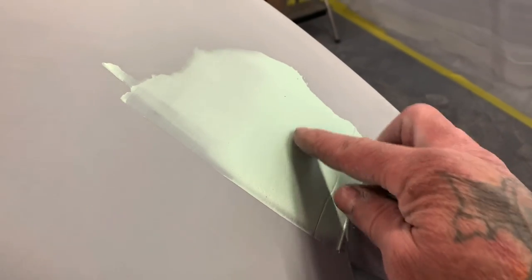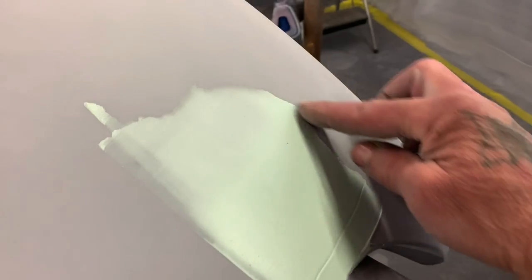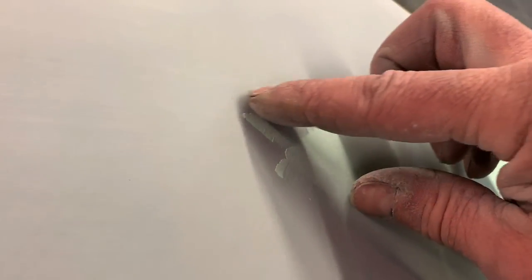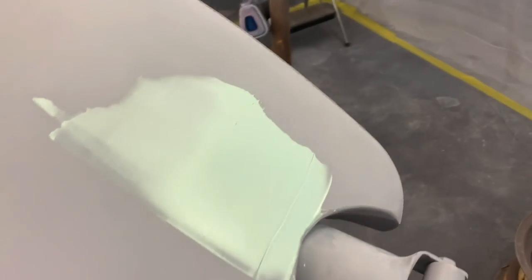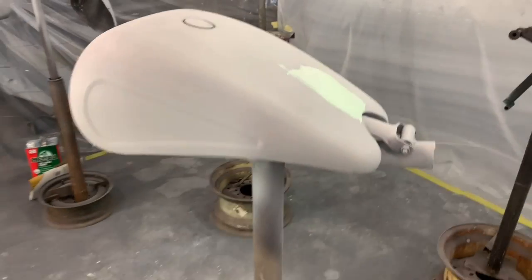It's faster just to take a little imperfection and wipe this putty like this, because when I'm done, this whole spot that I wiped will be smaller than this right here. It'll just be a little tiny imperfection that's covered up with putty, and everything else gets sanded off on the floor. And then I'll prime this tank one more time. This thing's done, it's ready for paint.